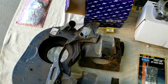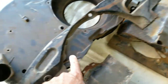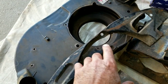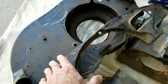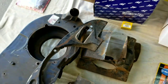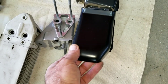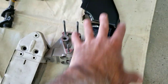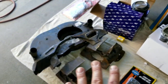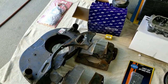We have our doghouse fan shroud — you need to have this. So you have your fan shroud with the doghouse. The doghouse fan shroud is going to run cooler than a lot of the old stand-up coolers, and you need to have this tin for the outside. It comes with that, and it also comes with these two other pieces. You need to have all of this on your doghouse fan shroud or it's really pretty much useless. All of that tin is required for the doghouse.